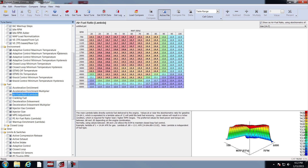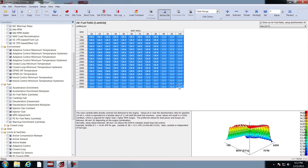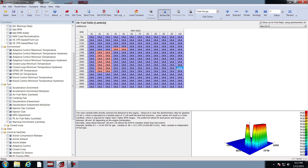Autotune basic will apply a Power Vision value file that sets the base fuel table to 14.6 to 1, and that's across all RPMs, all MAP and throttle ranges. It does this because that is the only effective range of the stock O2 sensor.